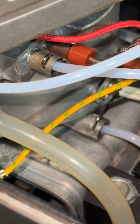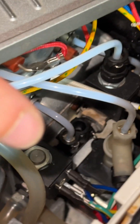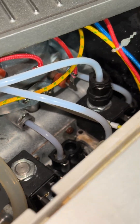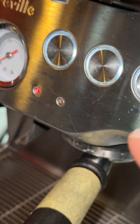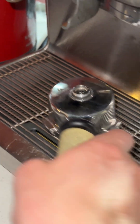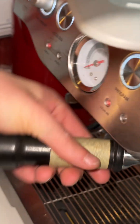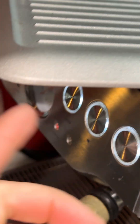The connectors are worn out and need to be tightened or changed. From my experience when I used to work at Breville, we would just change the entire thing — that's a $100 part, $120 with labor. I don't want to charge you $120 straight away, so I'm going to try to recondition this valve. It looks like it's working fine — it's directing water to the group head, doing all the right things, just leaking. I'll change the seals on it and see if it holds pressure.